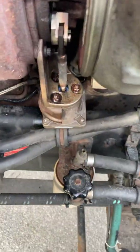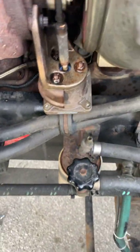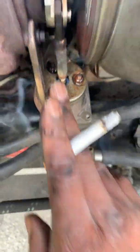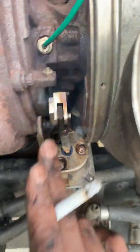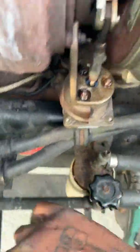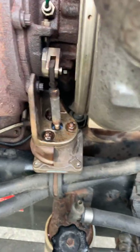Here you have your actuator. A good way to test it is through this line — this line goes bad a lot. Sometimes it is actually the actuator. Once you take this pin out, if that moves freely, that's moving the vanes in your turbo. As long as that's moving freely, the turbo is still good. I've already tested it — started up, took that off, hit it, and you get that jet engine sound.